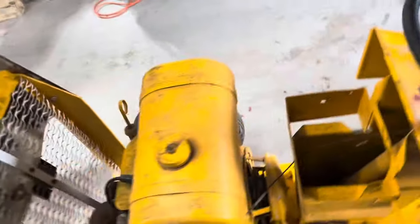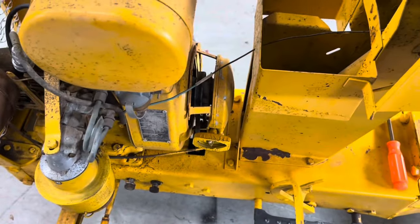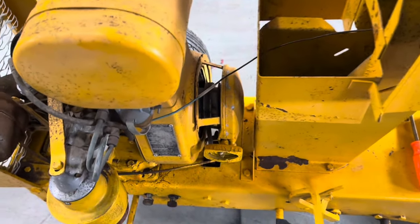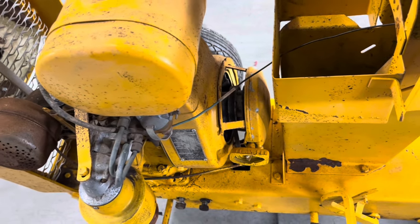Under the hood, you'll notice there's a battery compartment but there's very little to no wiring — that's because you don't need wiring on a pull start. The only wire you have goes to the magneto to ground that out.